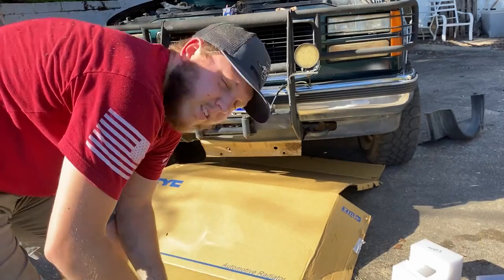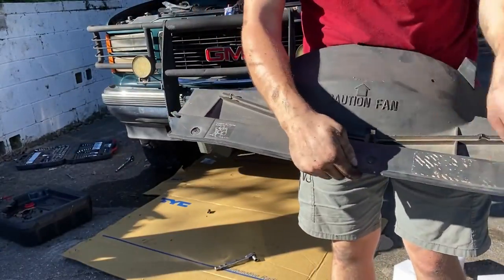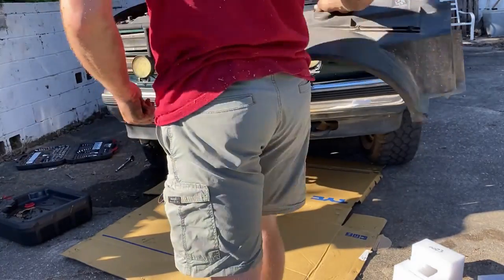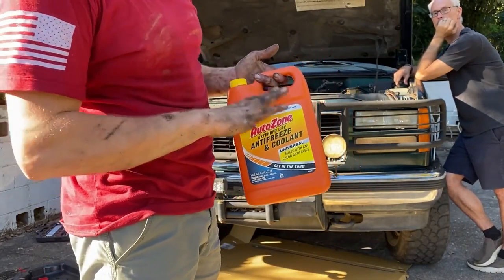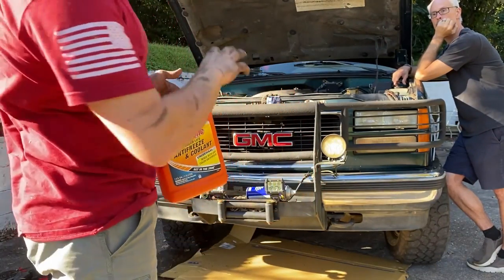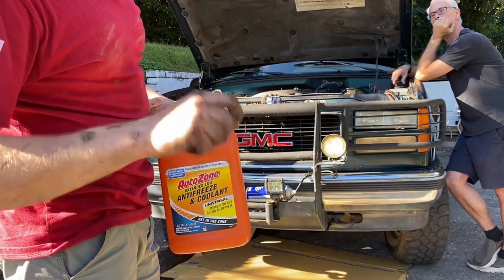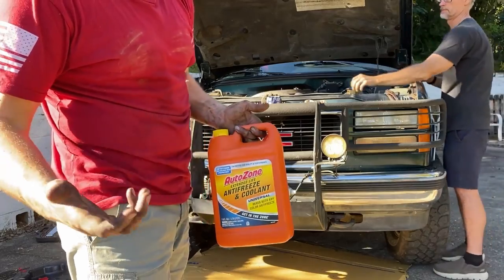Last thing is the top fan shroud - you go like this, one, two, three right here, and your wiring loom runs in this little channel under that clip. We're putting in regular antifreeze coolant - this is the concentrated version, not the 50/50, because you're paying a lot of money for half water - just do it yourself. Fill pretty much a full bottle into the radiator, all the way up, then add water as needed. Fill it all the way up, start it, and run it to circulate and pump all the air out of the cooling system - because if you have air in there, you can air-lock it, your engine overheats, and you did all this for nothing.